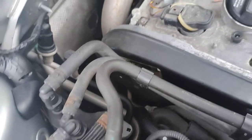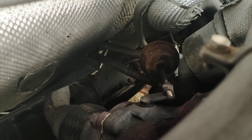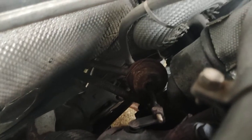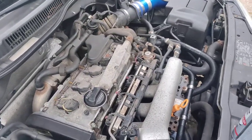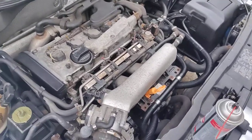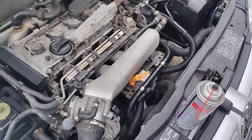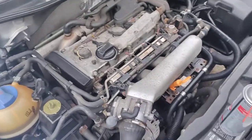I'm going to try to get this turbo down there, and you're going to see why we're going to do a turbo swap — because the turbo is in terrible shape. That's the actuator itself, and it's in terrible, rusty condition. I don't know how it got into such bad shape. There's the K03 that's under there. As far as we know it's still a K03. I believe this car's never been tuned — I tried looking in the ECU with a cracked version of VCDS, or Vagcom, and there's no signs it's ever been tuned.